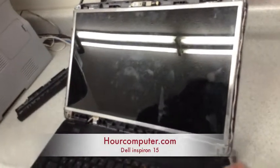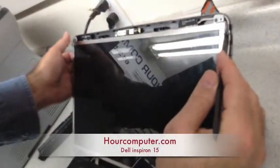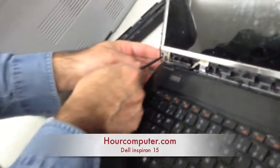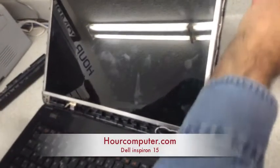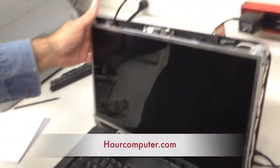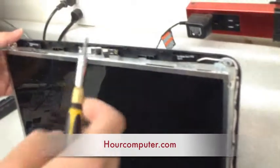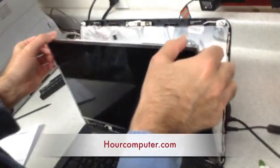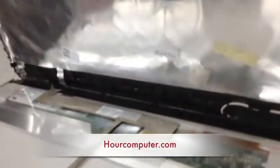Now what we're going to do is — it looks like it's a bit hard to get access — so I'm going to take out this screw and this screw, this screw and this one, these two up here. Bring it down, then I'll remove these screws on the side. I took out the screws from all the sides, and then I unhooked the camera cable right there. Now we're just going to bring it down a bit, and we're going to disconnect the cables off of the screen.